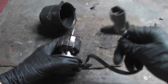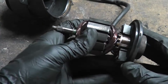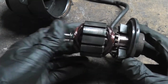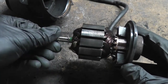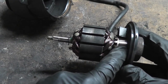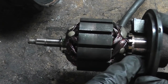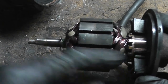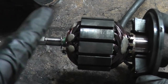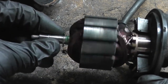In short, how this works: power comes from the battery, and those wires go to these two brushes. One is connected to battery positive, the other to battery negative. As the armature rotates, those brushes make contact with the segments on the commutator — the two brushes are making contact with only two segments at any one time. As the shaft rotates, the segments it's making contact with and the windings it's energizing change as the motor rotates.